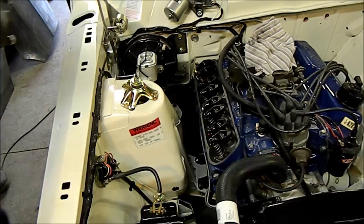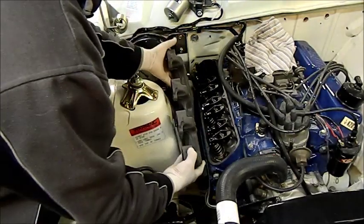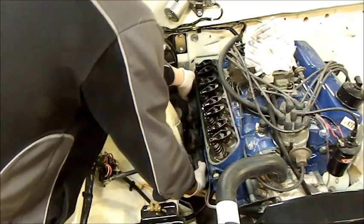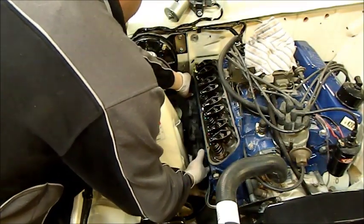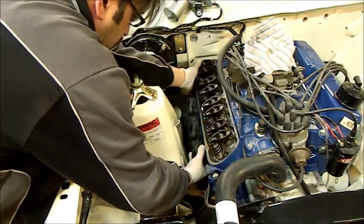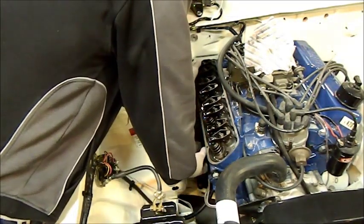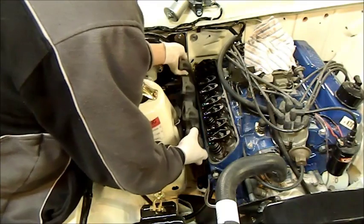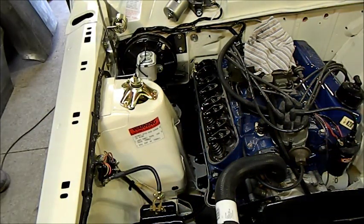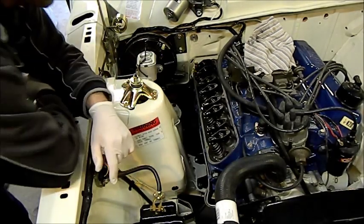Ideally, this is going to look a bit stupid what I'm doing here, but I'm sort of dropping it in back to front because I'm assuming that they're sort of a matched pair, and that's great. That sort of points right down. That would be excellent because that means the engine pipe can be fairly straight out the back and it would flow a lot better. This of course belongs on the other side, but I reckon that's probably the way to go. If I can find another Hypo Mustang one or Hypo 289 one for this side, that'd be the way to go.